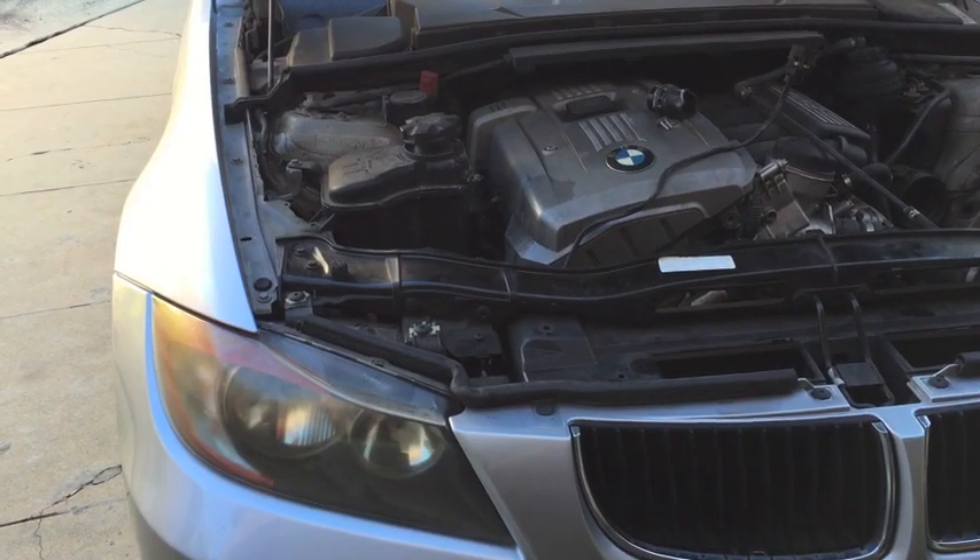And finally the bleeding process — BMW says this is necessary. For DIYers who don't have a battery charger, an informal method is to access the test functions menu in the instrument cluster to monitor your battery voltage during the procedure. Don't let it drop below 11.8 volts or you could wind up unable to start the car. As long as the pump cycles for around 12 minutes and you can read the menu at the same time, it should be worth a try. I haven't tried it because I have a multimeter and a jumper, so do so at your own risk.